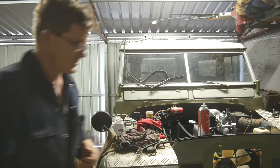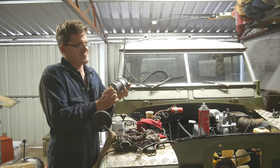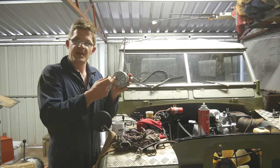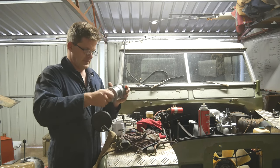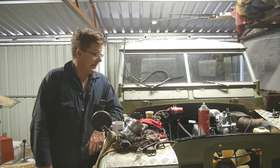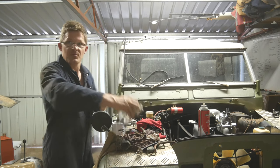And the CAV — I've got it just here. As you can see, it's a pretty large filter. I've got a drain so I can drain all the muck and crud just out the bottom of the filter itself. The good thing about this is I can just wash it out in some methylated spirits — or if you've got heaps of vodka at hand, you can use that, pretty much the same thing as paint thinners. Then I can just put it back and off I go again. I'll probably mount it up on the actual firewall.